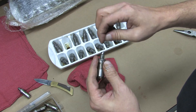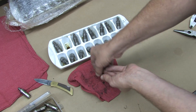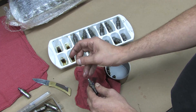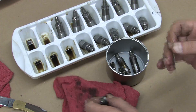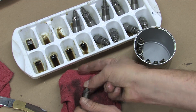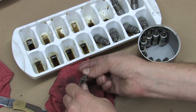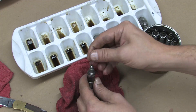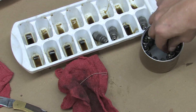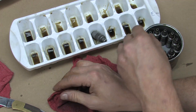Start by poking the check valve and pumping the lifters. Tap them out and soak up the excess oil, wipe them down, and one at a time place them in a clean container. I like metal containers when dealing with flammable solvents, and smaller containers because it takes less cleaning solution to do the job — that's less fluid to contaminate and dispose of properly. The upper piston has a fill hole in it that lines up with the outer hole. It's a good idea to rotate the inner piston to line those up so that pumping the lifters in your cleaning solution has a better chance of blowing chunks out. It doesn't matter which direction it faces when installed — there's an oil groove that supplies oil no matter which way they're facing, and it has no effect on the check valve, which is what's doing all the work.